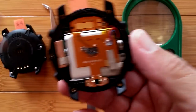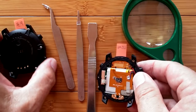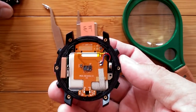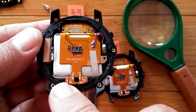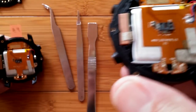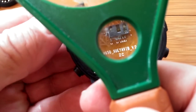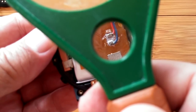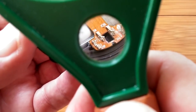Before I begin, I wanted to compare a few things between this broken LEM6 from water intrusion and the fully functional F3 with identical build. I popped the back off the F3 and look how clean it is — all around the heart rate sensor and those connectors. Now look at the level of corrosion that's happened on the LEM6. See around the components? This is what happens if you get just a little bit of water in here. So even though your waterproof watch may claim that it's fully waterproof, if it gets just a little bit in there the corrosion is horrendous.